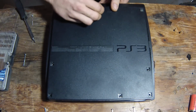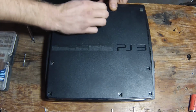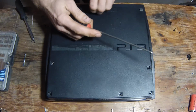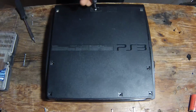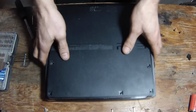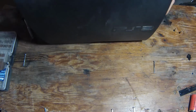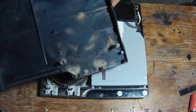Also, there's a warranty void sticker if removed. The sticker right here. Obviously, if you pull this off, you can't warranty your system. That's that one last cover you gotta pop off, and remove that. Then after you get all your screws out of the system, go ahead and flip it over. Remove that cover and open her up. That's her. See, there'll be lots of dust in there.